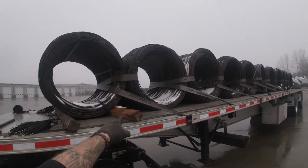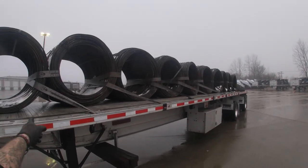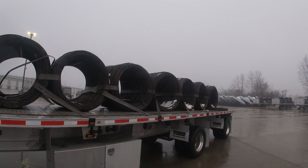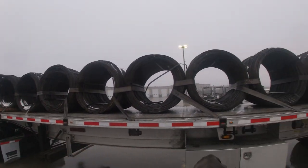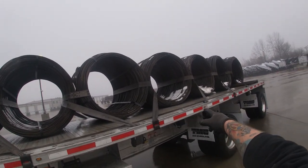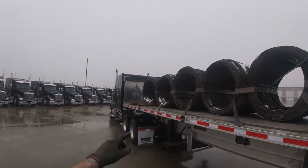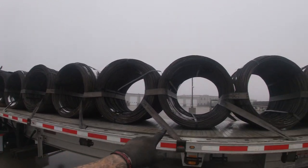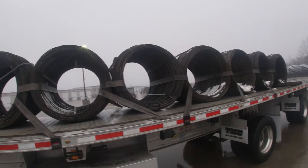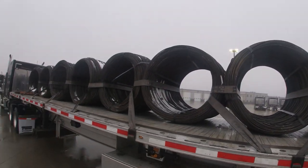Four-inch straps are on. We've alternated all the four-inch straps, Xs are sitting in the center of the coils — looking good. We've got the first six pulling away from the driver's seat, and the last four pulling towards the front. So if some four-wheeler cuts you off and you have to hit your brakes hard with a 75,000-pound load, you don't have to worry about this load going into the back of the cab. That's the whole point of the directional split.